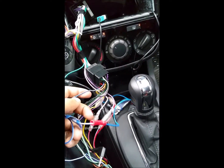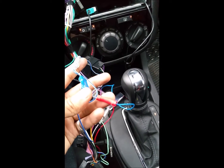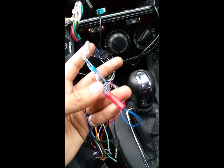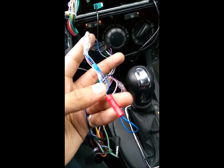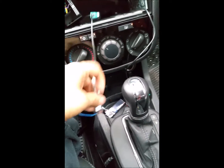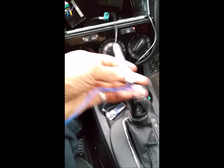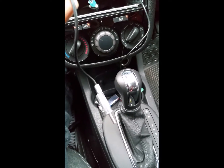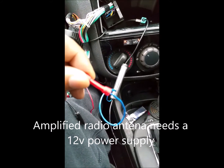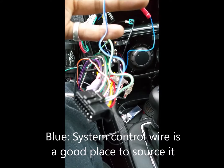And then here you've got the radio controls. I had to wire this properly — I had to crimp it because the person who originally installed it, a professional installation company you can find in London, didn't actually install it properly. They left it hanging loose and I couldn't figure out why I couldn't get the right signal into my radio settings. Because this is a type of aerial that requires a power boost, and that looks something like this. This goes back into the stock, and this orange piece is an adaptation — that was the adapter you saw on the back of the head unit earlier. It needs to map into where the remote control start would be for your amplifier, but you still have enough wire to add an amplifier if you wanted to. Then that maps back into the head unit in the main loom.